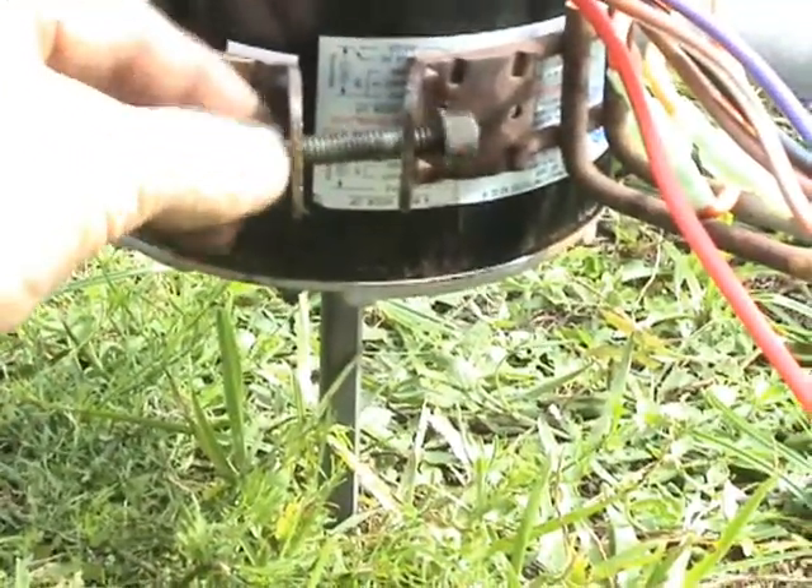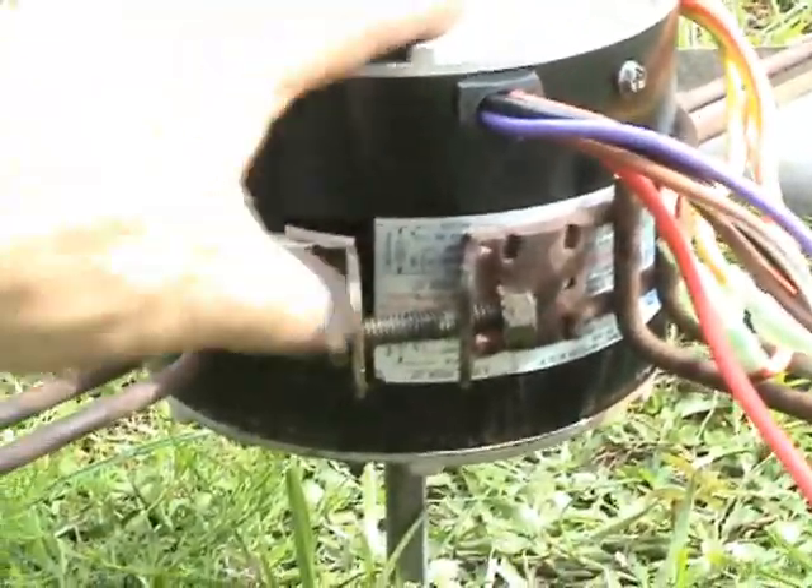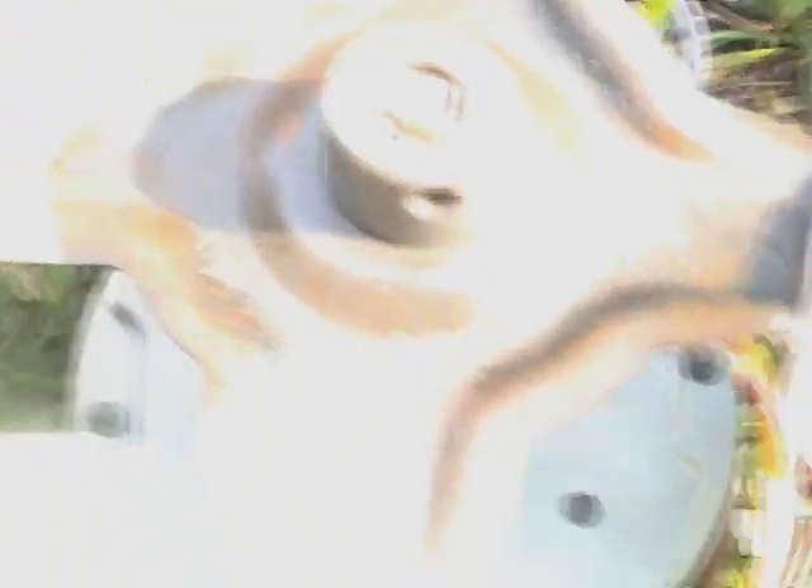Now I just have to tighten this so that the motor will stay in place while it's moving - and there you have it, nice and tight. Now it's time to put this fan blade back on the shaft. Usually it'll go on pretty easy. If it doesn't it means that you've got a problem with the hub, probably especially if you're putting it on a new motor. Now that I have the fan blade in position, this thing's ready to put back in place inside of the air conditioner.